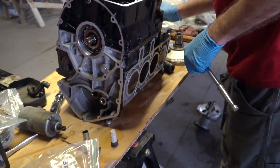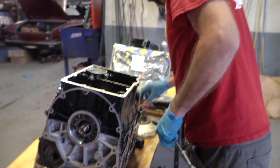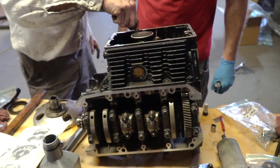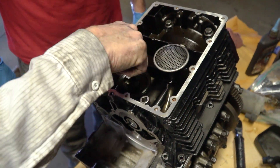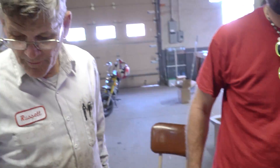And you notice that the oil filter is in the oil sump. This is where the oil filter screws on, so you've got to take the pan off. There's a separate hole in the bottom of the pan to get the filter out, and you need a special wrench to reach in there because the opening's not big enough. It's a BMW.